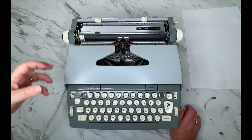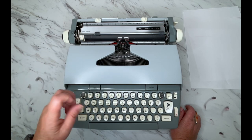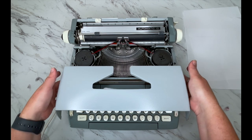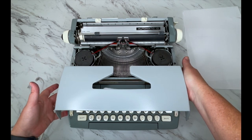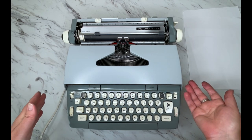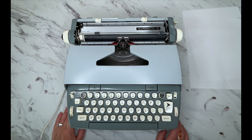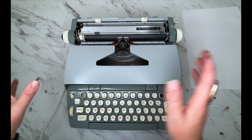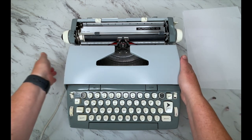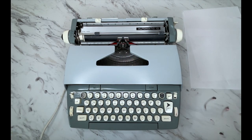If you've picked it up and inadvertently pushed the cover, it'll start to rub against that metal piece. So if you hear a grinding noise, that means the motor is rubbing against the cover. The way to take care of that is to gently open it up, take your palm, and gently press just a little bit, then close it and make sure it's not grinding anymore. If it's still grinding, just repeat — but please do it gently because you don't want to bend the cover. That is a common issue: the cover gets pressed over and you have to push it back.